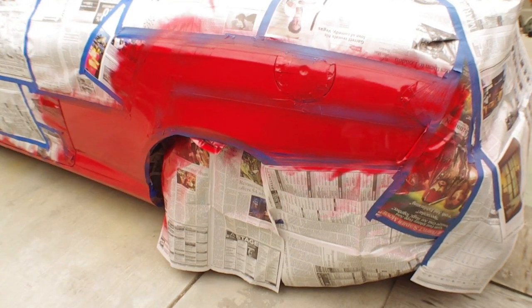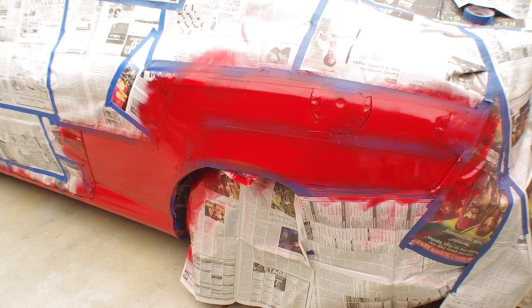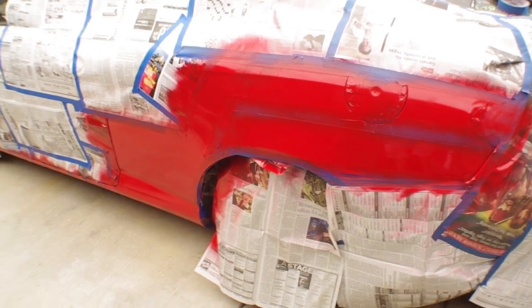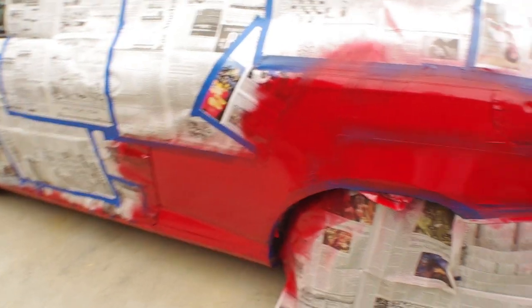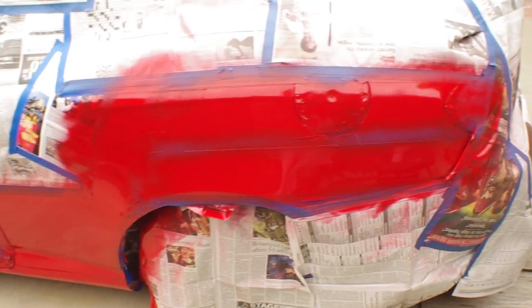The burgundy was in fact too purple. The dark red was wrong. The sunrise red is a little bright, a little orange — but I'm going with it. I'm going to have to leave the paint on here for a while and give it a second coat, then start taping up the other side. The stuff did go on thick, unfortunately, and that started causing a few issues. I can't see what's going on here with the camera — it's too bright out. But there should be some fisheye going on in there, and there are a few drips in other places. Par for the course. I'm going to start taping up the other side.